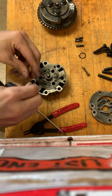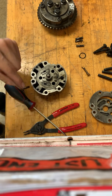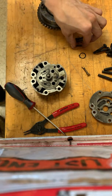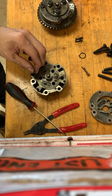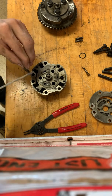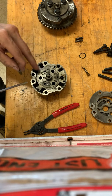We do not want to slide it in the wrong way. We want to make sure that the metal piece is facing on the inside, and then slide it in like that for your outer ones. Now for these inner ones, it's the exact opposite — you want the metal to be facing towards the outer gear, because the plastic side is going to be rotating inward through oil pressure to either advance or retard timing as the car needs it.